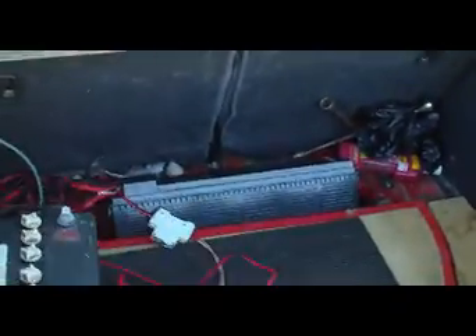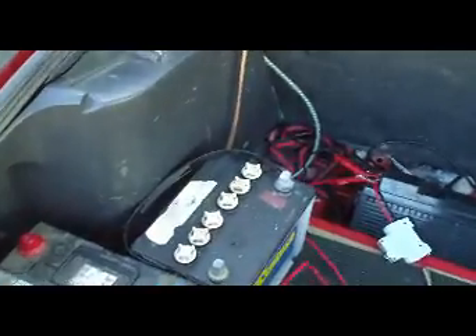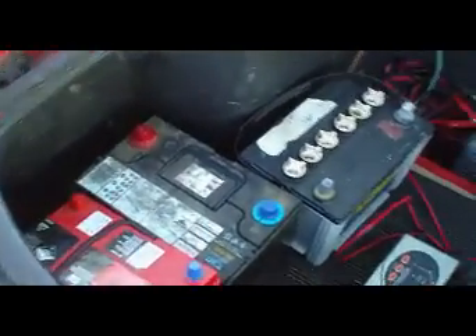You've got the idea — you could try this yourself if you have this problem. If you want to go any serious distance you do need a decent deep cycle battery, although it doesn't have to be AGM. At a push you could use an additional standard starter battery or a couple in parallel if that's all you've got, but deep cycle is definitely the way to go. This auxiliary battery doesn't really start the car — the original battery still does that — it just helps run the car. So there we go.